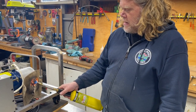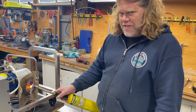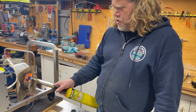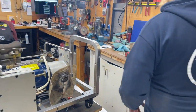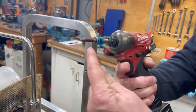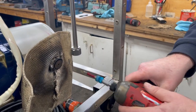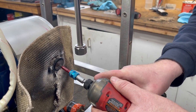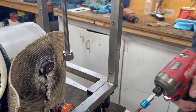If I take the heat off and grab my screw gun and find any type of resistance, I'm going to remove the screw gun and apply more heat — the screw should come out easily. Now with a three-millimeter impact driver bit attached and set to reverse, I'm going to give it a quick pulse. Now that I know it's free enough, I'll go for it. Don't touch it — it's hot.